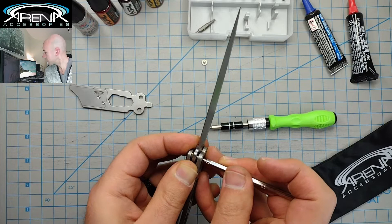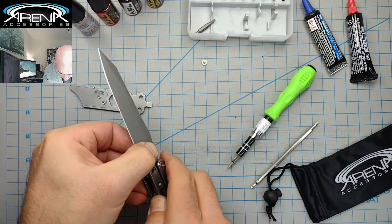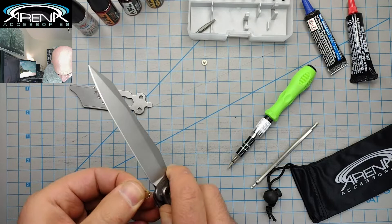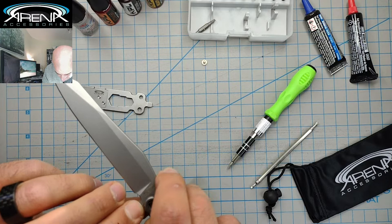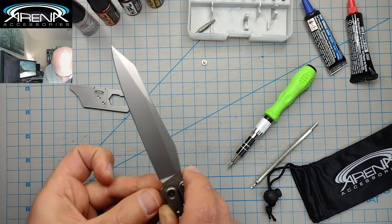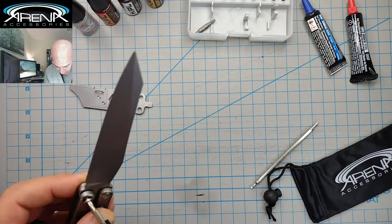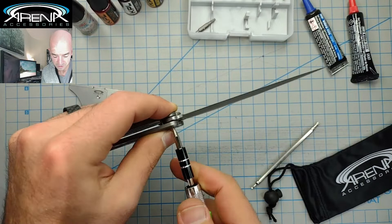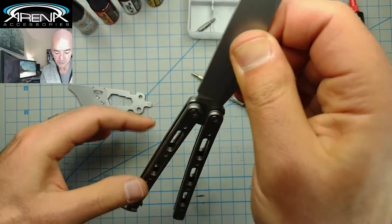Hopefully you can see this on the video — I'm just pushing through. Just shimmy it a little bit. Once you get it like that, hold it with your thumb. Pop on the bearing, get that seated, and then pop on the washer on top of the bearing. Take your screw and snug it in. You don't have to kill the torque level — just snug it. You'll know when you're done. It'll come to a stop. If you over-torque, your handles aren't going to fall as smooth.